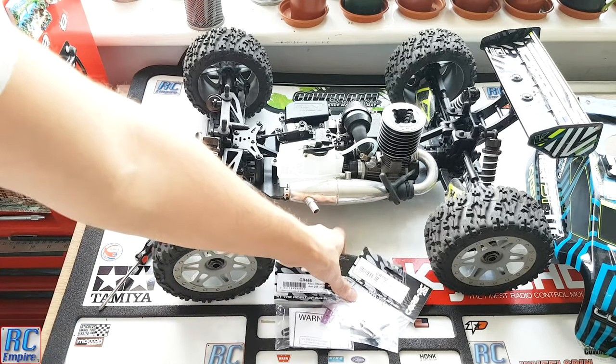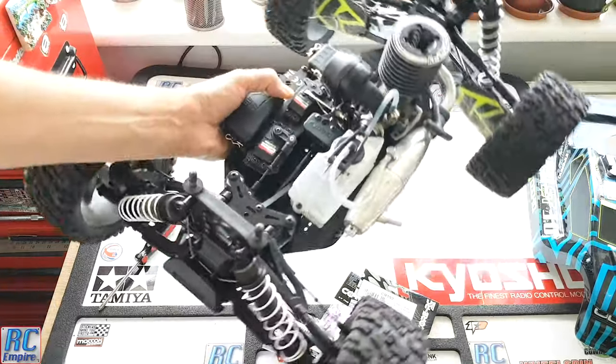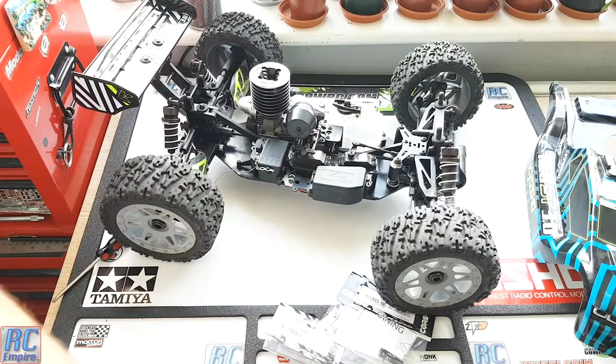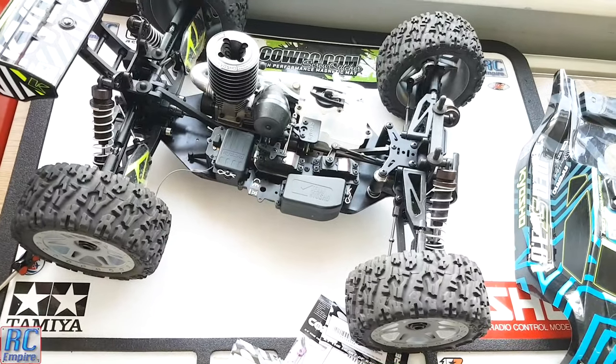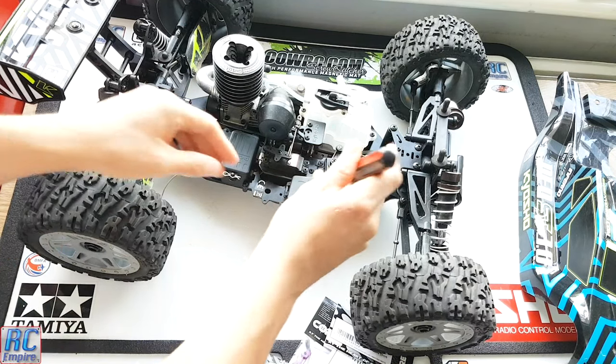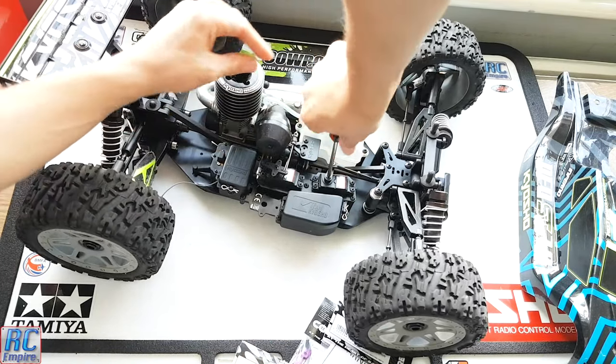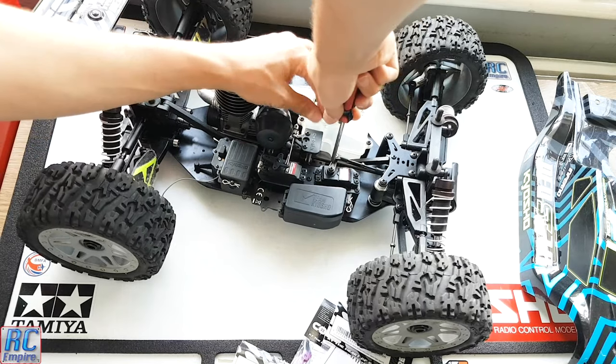Now, as you can see, the first one we swapped was a plastic one, and what you need to look out for when buying servo horns is the number of teeth on the horn. Typically, Kyosho, Futaba, Savox servos all use the 25 tooth servo horns. And that's exactly what these Kyosho servos use here. But that plastic one we put on stripped again after a jump.